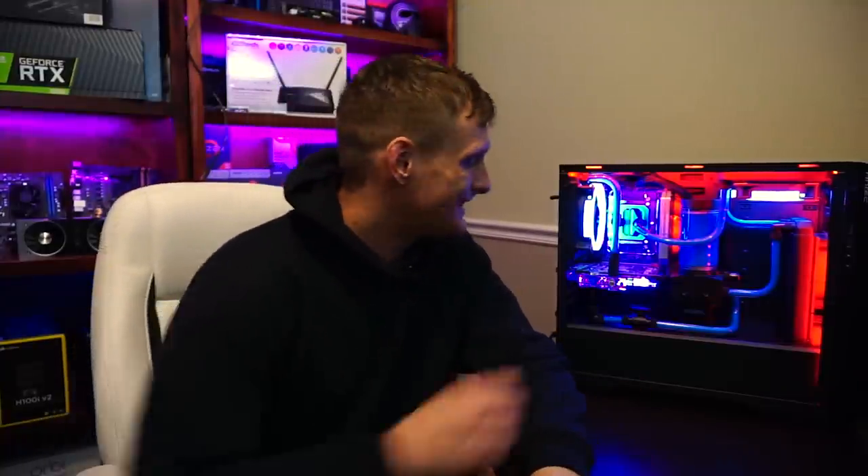The biggest thing I'm going to always implement going forward is going with thicker tubing — that way I won't have to worry about the heat — and I'm always going to put at least a small extension coming off of the blocks, at least if I'm going with 12 millimeter outer diameter. It could also be that the tubing I got wasn't good tubing on top of it. If the tubing warms up like that it shouldn't shrink down, but some of that in their defense could be the different chemicals in the different dyes that have been in this system.